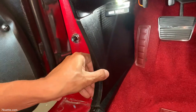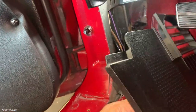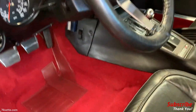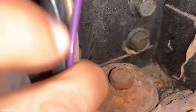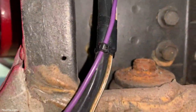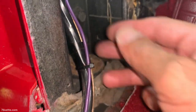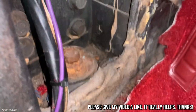I'm gonna use my car as an example. What you want to do is remove the sill plates at least, so you can inspect this portion of the birdcage, which usually is the one that gets the most damage because of how water sometimes finds its way in there. What you want is an area that is ideally 100% rust-free — you're always going to see a little bit of surface rust — but you want something that is dry and doesn't show damage. Those four bolts there are the ones that secure the bottom door hinge to the pillar, and then you have four more up on top. If this area is weakened, you're going to have all kinds of issues with that vehicle.